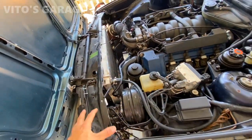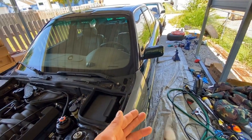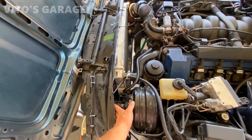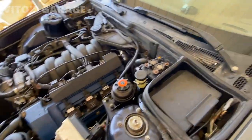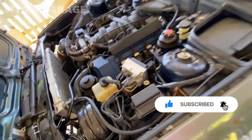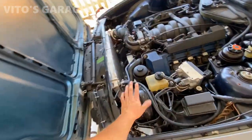I got really frustrated and started undoing stuff on the brake system. I unscrewed and moved the master cylinder out of the way, then pressed the brake pedal to see if there was a difference — but it was still no different. So I knew it wasn't the master cylinder. After that, we looked at the pivot pin there. The brake booster is right here with a rod mechanism that goes all the way to the brake pedal. We undid that mount and tried the same thing to eliminate the booster as a cause.